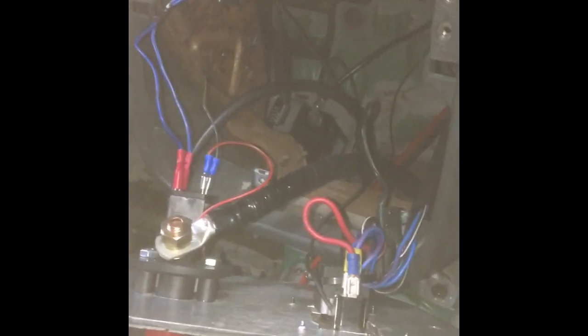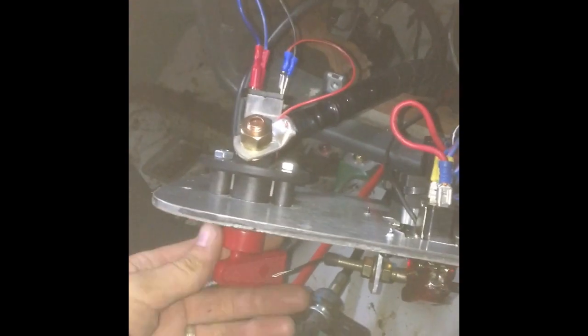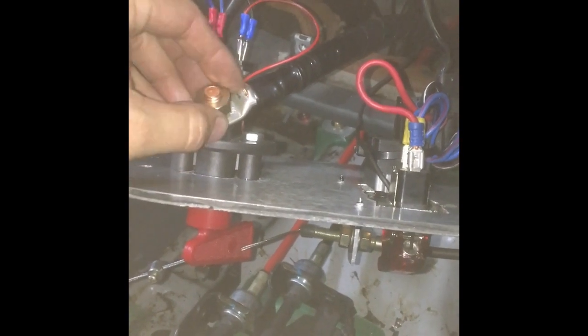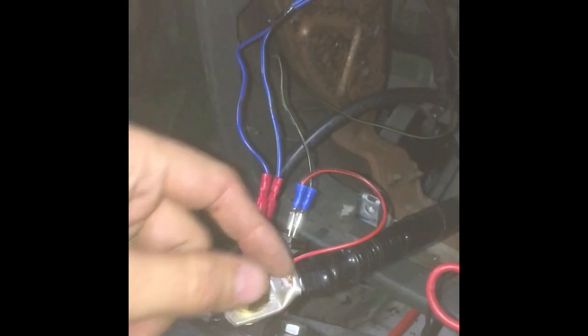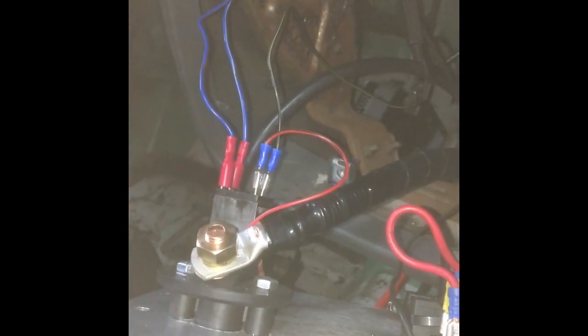That's really not safe. The other important thing that a lot of people get wrong is these other two contacts - these are normally closed when the switch is off, and that's really important. What this does is give the alternator a safe place to discharge to ground. On the positive wire we've got a jumper going to this contact, and then from here another wire goes through a little resistor - I've heat-shrinked it up to make it look tidy - but there's a little three-ohm resistor supplied with the Luxe Performance six-pole isolators, and that goes to earth.